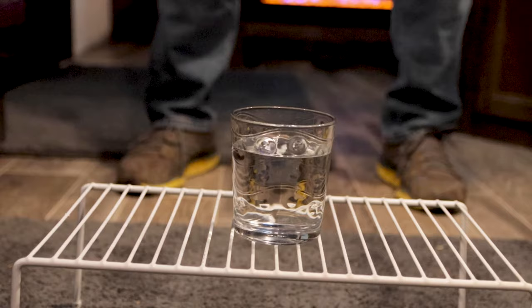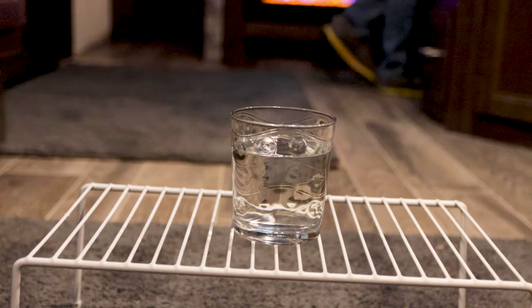As you can see here, this is what it looks like with the stabilizers up — the water shaking back and forth all over the place. Then with the stabilizers down and everything locked in place, you can see how much more solid it is. The water's not moving around in the cup as much. That is what the stabilizers are meant to do. When I put down my stabilizers, I didn't go out there and crank them down trying to level the RV with them. All I did was put them down, get them snug, and let them take care of what they do — stabilize my camper.